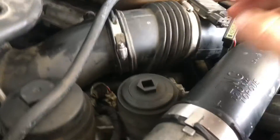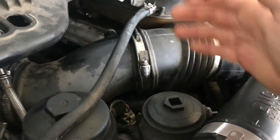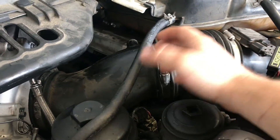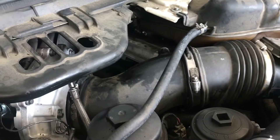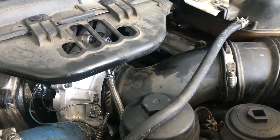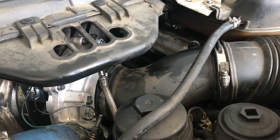Boost tubes are good. When you start this truck up, you can take the air filter out right here - loosen it up, pull the whole air filter out, start the truck, and at idle you can put your hand over this opening. It's going to have some pretty good suction. You can also use a piece of wood and watch it get sucked in - it'll start collapsing. There are two different ways to do a leak-down test and this is probably the easiest one.